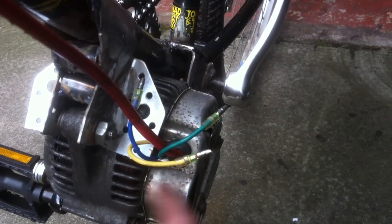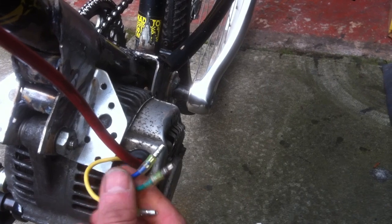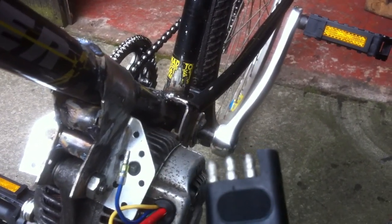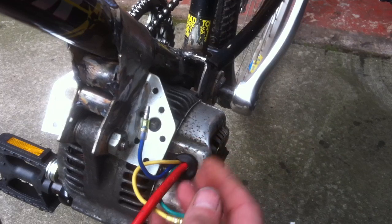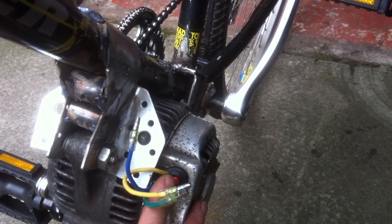In terms of the conversion of the motor itself — I didn't show that, but everything is in the casing. I've just taken out the regulator rectifier and wired three bullet connectors on — these came off a controller which had bullet outputs, which is a bit strange, but never mind. And I've just taken the field coil out to what's going to be a 12-volt battery, which will eventually go through my PWM. But for the time being, just to test this, we'll have a 12-volt battery on here and an 18-amp controller on these. We'll just see if it works without ripping the chain apart. Watch this space — thank you.